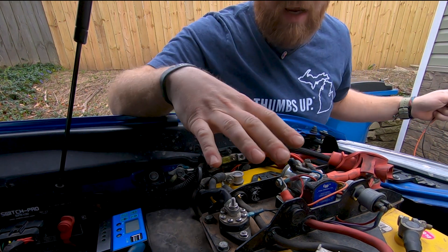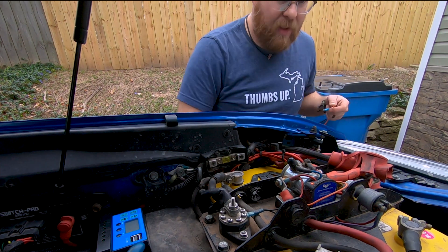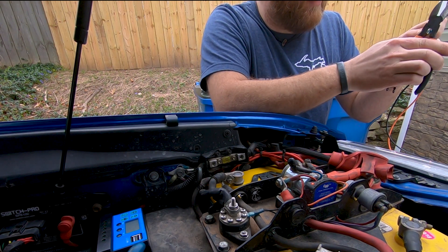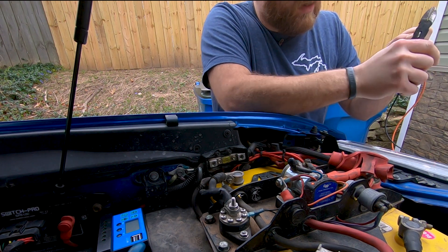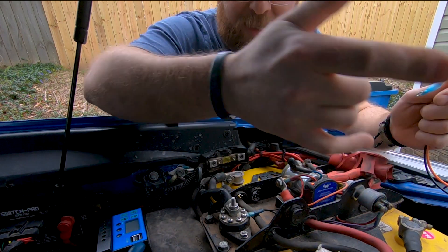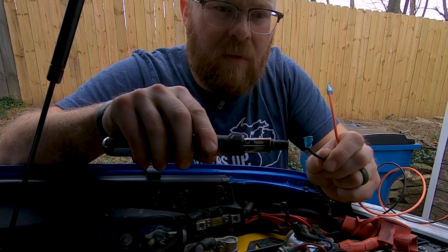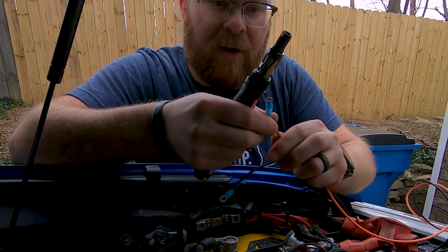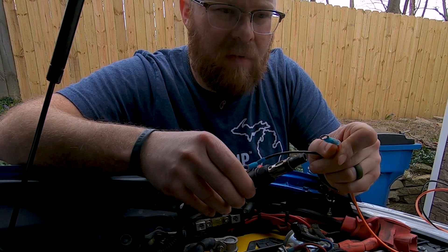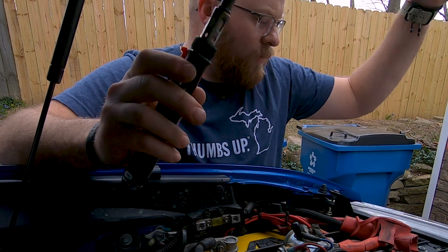There's another cool feature where if your starting battery is drained but your accessory battery is still good, you can push that little button and it will connect both batteries so you have both connected to start the vehicle. Really awesome setup — it manages charging too, so all we have to do is connect to one battery and the smart isolator handles all the charging. In an emergency, if you needed to charge the starting battery while stranded, you could just take these two cables and tie them directly to the starting battery. These heat seal connectors work awesome, as do butane soldering irons — a great thing to throw in your toolkit for emergency repairs.